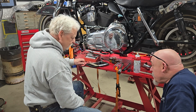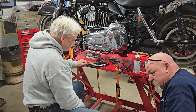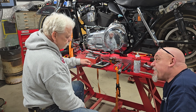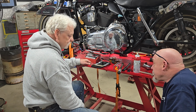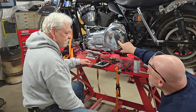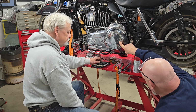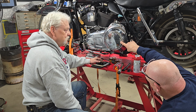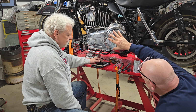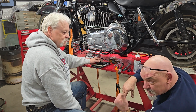Because I'm willing to bet most of this stuff, if you've wrenched enough, you're gonna feel when something's good. I wouldn't feel on major parts, components for your engine or your wheels or brakes or things like that. But an oil drain plug, I think we'll be okay. We'll know when that rubber crushes, and we'll go from there. And then once we get that tightened up, we won't bore you with taking off this derby cover. We'll pop it off. I hope that I have the O-ring for that, if it's an O-ring. I think it is. And we'll go ahead and put in, I think it's a quart. We'll do a little drawing of how far you should fill it up. By the way, this is the primary fluid, so plug is right here, and then we'll start filling fluids on the other ones. So we'll catch you here in a few.